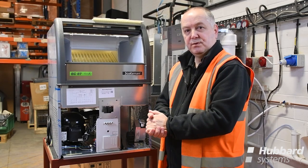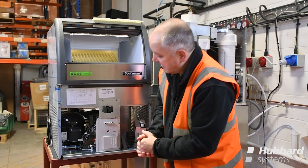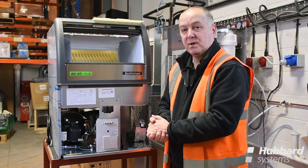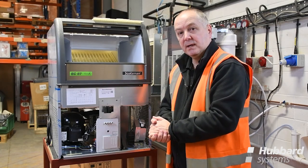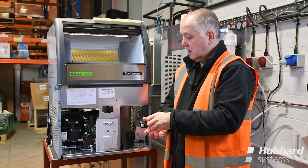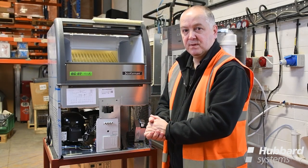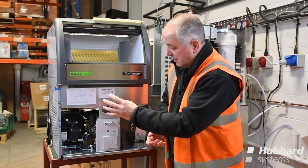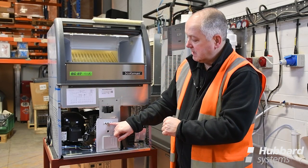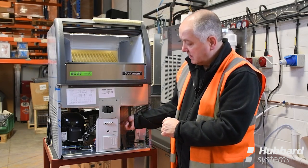Attending a service call for noise coming from the refrigeration section of the machine could relate to the fan motor where it has become possibly detached from its bracket, the fan blade has become loose, or the noise from the motor could be the bearings failing, in which case the motor requires replacement. Also consider that a non-working fan motor could bring on a single red LED high condensing temperature light as measured by the sensor mounted in the condenser.